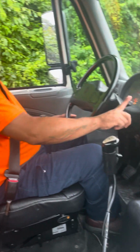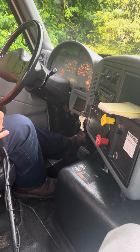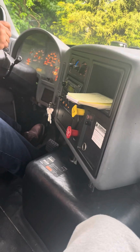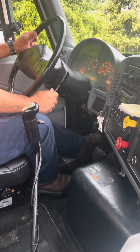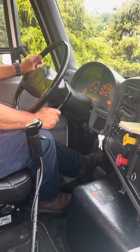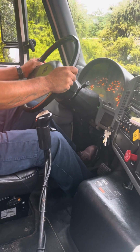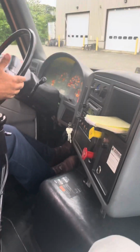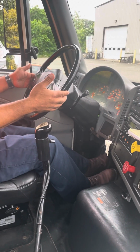We'll continue my brake test by next checking my trailer service brake by driving up to 5 miles an hour. My trailer service brakes are working properly. I know this because we came to a stop. The next test is going to be my service brakes. Again, I'm going to drive up to 5 miles an hour while lightly holding the wheel. My service brakes are working also. The wheel did not move left and right, indicating my brakes are properly adjusted.